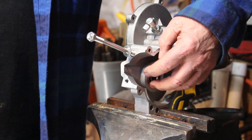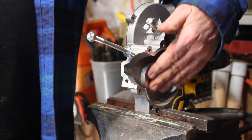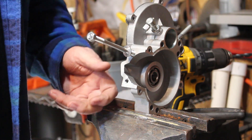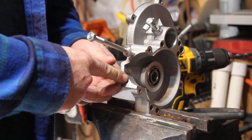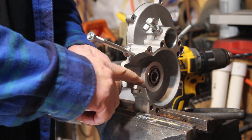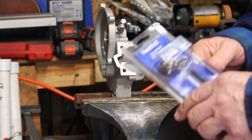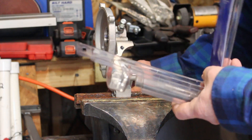You can pack some rags down inside to make sure you don't get anything in there. Get your shop vac and run it right next to where you're drilling and tapping the hole. When you pull your drill bit and tap out, you can get everything out that way. I recommend if you're doing it with the engine assembled, be sure and stuff the inside with some rags so you don't get junk down there. And we're going to put one of these helicoils in — let me show you what's in the helicoil kit.